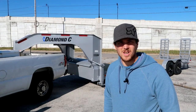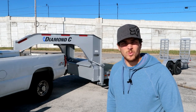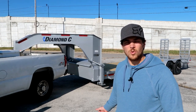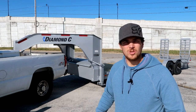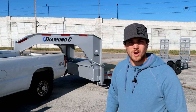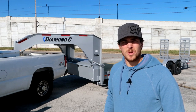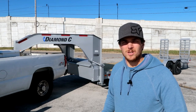A little bit of details on this trailer: this is a tandem 7,000-pound axle for a 14,000-pound capacity. You can upgrade the rating up to 15,900 pounds with the gooseneck — that just depends on your tow vehicle, and you have to do that on a new trailer from the manufacturer or dealer. This is a 24-foot with, I believe, a 2-foot dovetail, and we've got the extra-large ramps on this one, a 36-inch step up here, a few minor upgrades. We also have a spare tire up front and a winch plate. I'll do a completely separate video going into detail on the specs, what I picked this up for, the price I paid, and what the MSRP is. But let's get to the inspection video and show you all of the flaws.